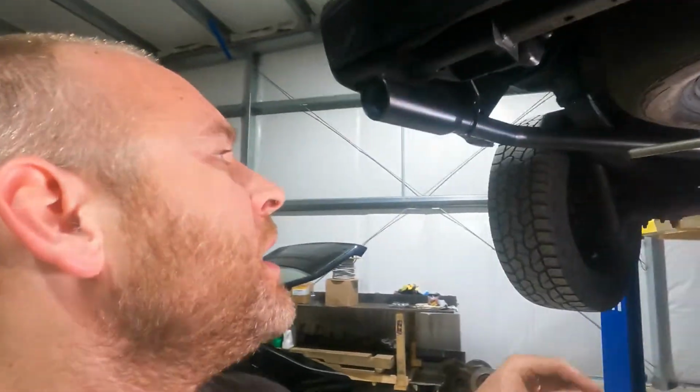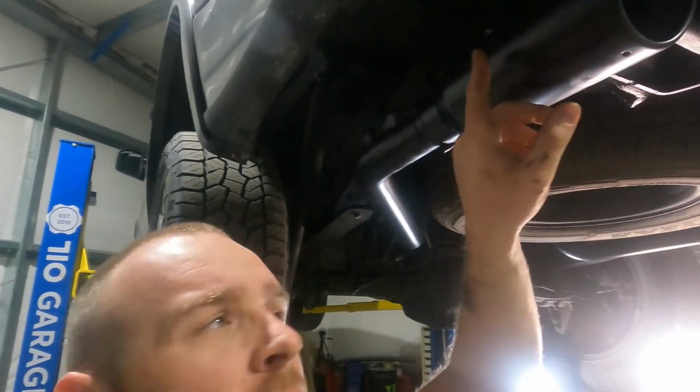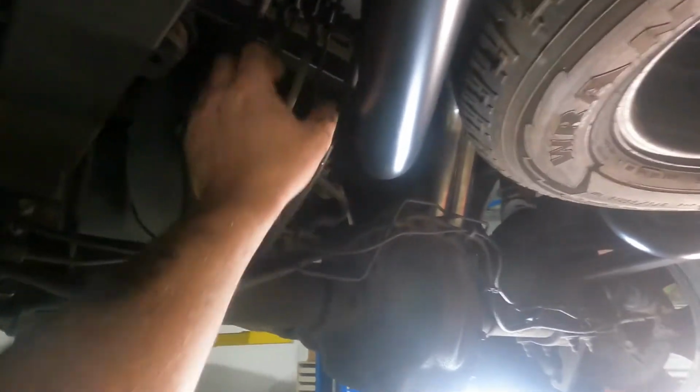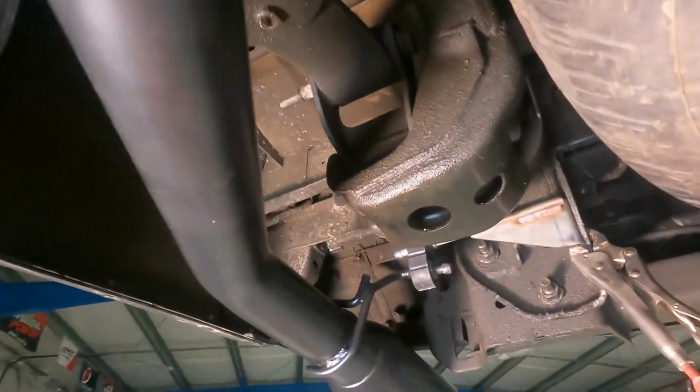So over here, if we look at this side, I didn't take you guys through the painful learning process to get the driver's side mounted. But if you look, it comes through and we have good clearance to the tire, and on this side I'm going to have to pull all of these wires back this way away from that exhaust, as we don't want them flapping this way and hitting. But it all comes up, looks good. The two pipes here are really close up there in the top, but we will be able to spread them apart a little bit. And then following back here, it gets kind of close to the leaf spring, but once this goes up, I think we'll buy ourselves a little bit of room. So that's what we're looking to do.